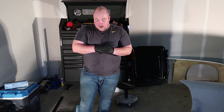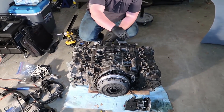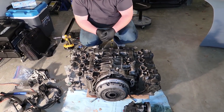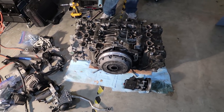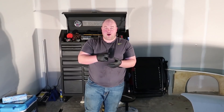I went ahead and off-camera got all the stuff off the top end of the engine. We got the front accessories off, the secondary, air pump, the starter, all this stuff right here — heat exchanger. So at this point we have a pretty bare engine, which is what we want. I'm going to get the impact out and just start breaking bolts, tearing into this thing. Let's do it.